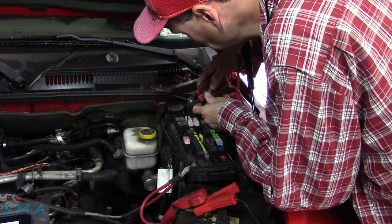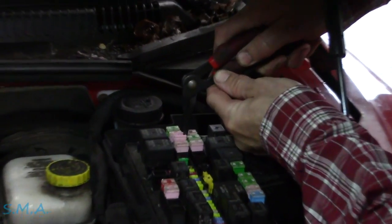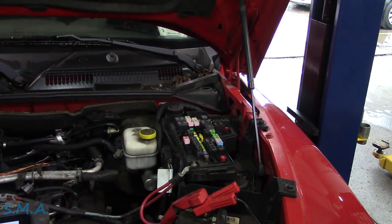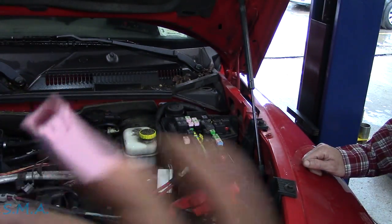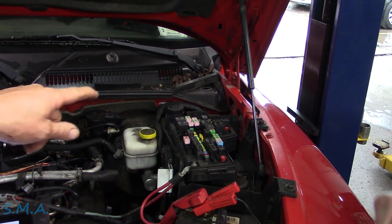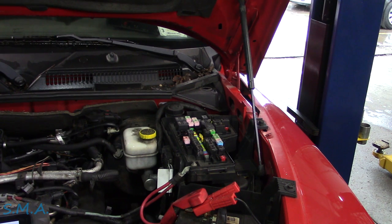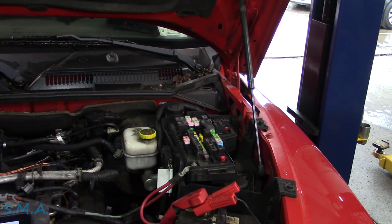So it's a big J-Case fuse. Jason's going to pop that out. We're not going to play stupid and just plug a new fuse in. Jason's going to grab our circuit breakers — we're going to plug a circuit breaker in and see if that blows, because if something happened during the clutch job and smoked the fuse, I want to know about it before we go popping new J-Case fuses. She blasted right open — split open. Standard classic 30-amp J-Case.